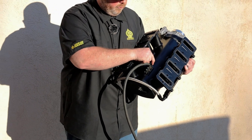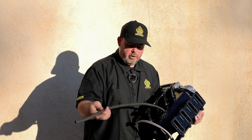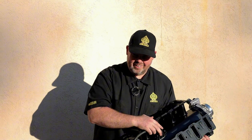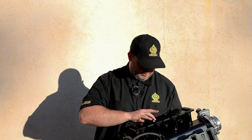It's a maintenance thing. I'm going to use a better cap — I'm probably going to pull these out and put plugs in them. I've got my hose over here for my brake booster, and that's important. You want to install these kinds of things before you put the intake on, otherwise you have to take it back off. It's no fun.